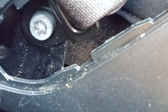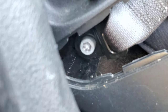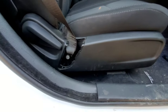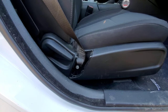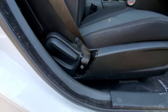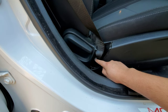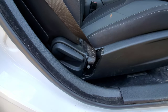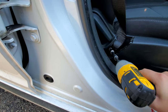I severely struggled with this bolt and almost stripped it — it's like a second away from being stripped. Don't make my mistake. Get a really strong impact, or a breaker bar, or a heat gun. Heat it up hot enough so the loctite starts to loosen, then hit it with the impact and it just comes right off. Hopefully that's what's about to happen here, or we have a repeat of last year.